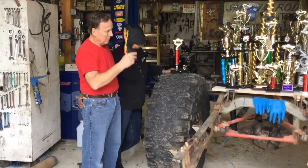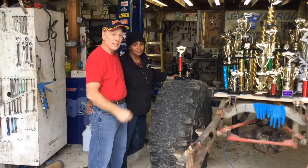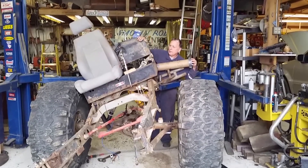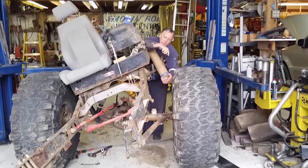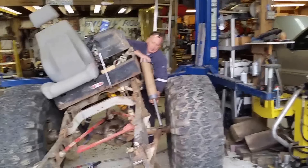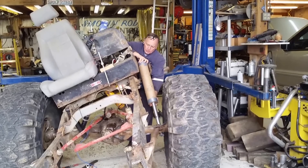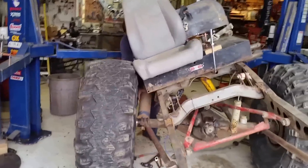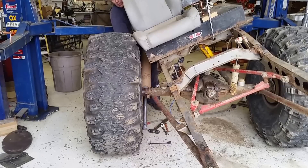We're going to pay homage to this honey over here. A moment of silence. One of the goals of Super Jeep is always to maintain seats for the passengers, for any kids. You saw earlier the shocks kind of don't work at full compression. So on paper, it looks like we're going to cut the back of this seat off here, set the shock in about like that. This simulates a 14-inch coilover, two-and-a-half shock body — that looks pretty damn good. Unfortunately when you go to this side with the same mounts, you'll see at full compression the shock is basically laying on its side, which means we're going to have that same problem — the shock's just going around a circle, not actually compressing.